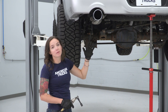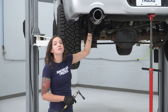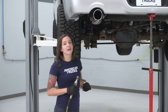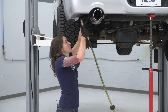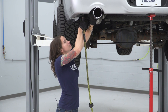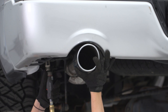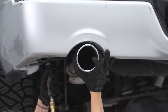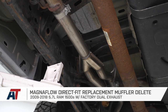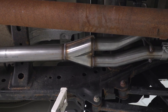If once you get your tailpipes tightened down the tips don't line up great with your bumper, you can definitely loosen the clamp right at the back of the tip and adjust that slightly. Grab your 13-millimeter socket and adjust this now. Once the tip is lined up nicely, go ahead and tighten this down. That is going to do it for the review and install of our Magnaflow muffler delete. Remember, for all things RAM, keep it at americantrucks.com.